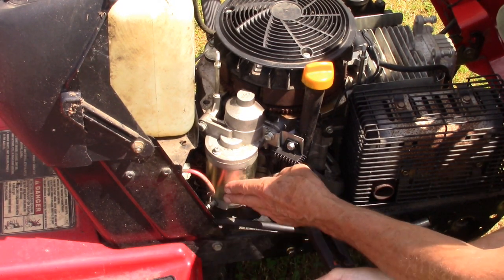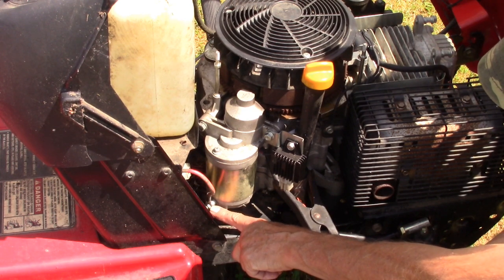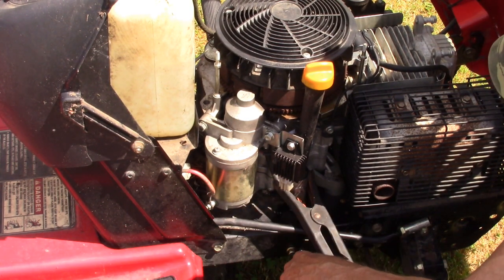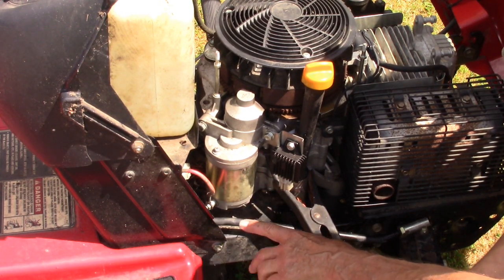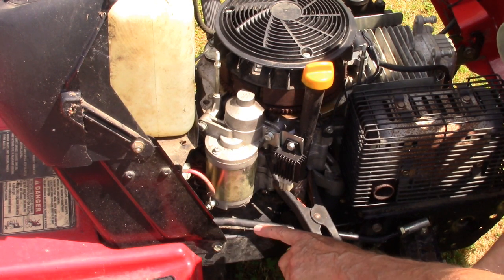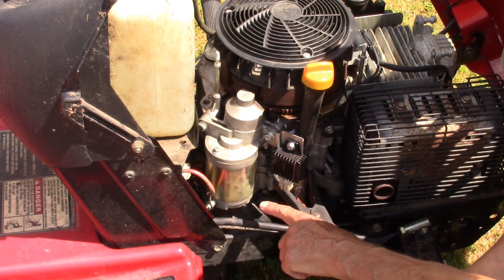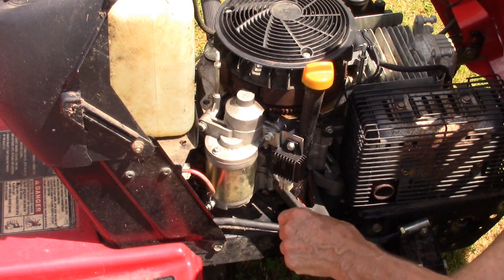Now, once the battery cable is connected to the ground, you do not want your positive cable to touch any of the metal. You only want to touch the starting wire or the terminal here. So you got to be real careful because of the close proximity to the metal on the starter housing. Now when you do this, caution that it will throw a spark, so don't jump when it sparks. Jumping could make you hit one of the other metal, and that would short out your battery.